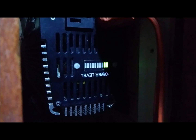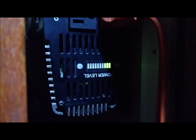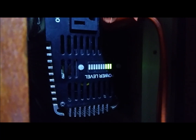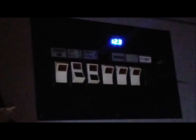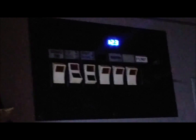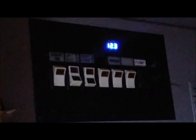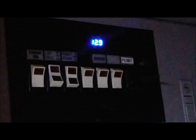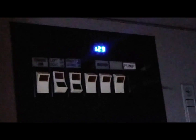There you go. You see it's barely consuming anything — it's just into the third bar, barely. I actually consume more running my coffee maker or my electric drill or something. The starting capacitor made a huge difference. You can see it — twelve point three while running. That's line voltage, so it isn't my actual battery voltage. When the compressor cuts off, you'll see that the actual battery voltage is much higher. The compressor just cut off and you can see the battery voltage is climbing back up to the 13.3 that it was at.